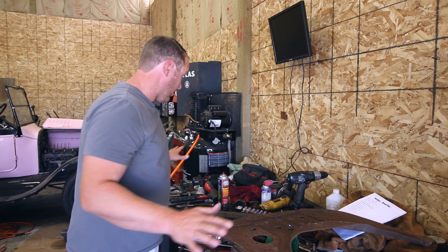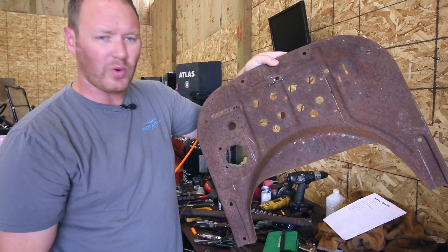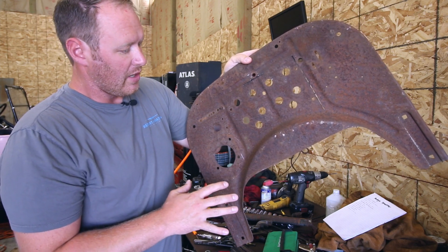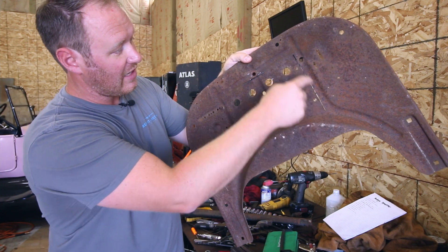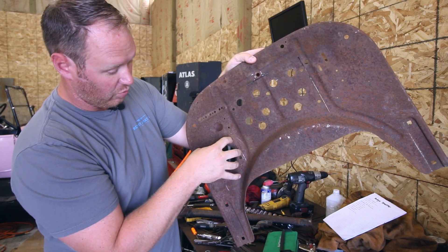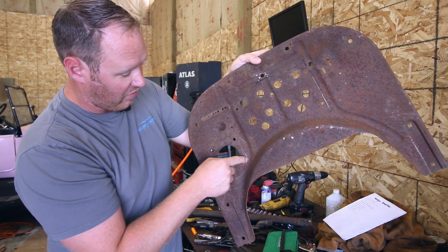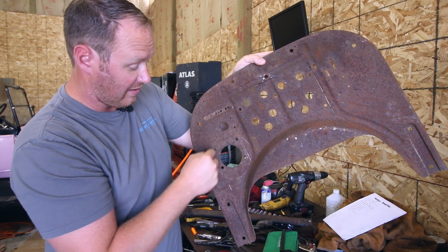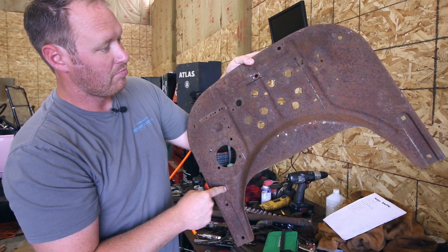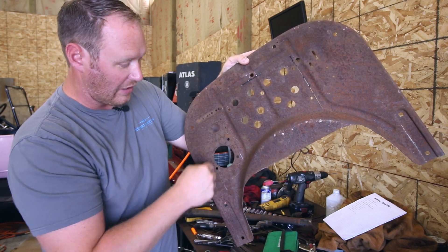Pardon the mess, because there's a lot of it. What we're going to work on is the firewall — here's the replacement firewall. We're getting rid of the wood firewall to go with this steel firewall. In order to clear the cylinder head, we're going to have to cut this section of firewall out. We also have to move the steering gear mount — we're going to move it two and a half inches down into this position, then fill this back in. I've got the new bolt location marked, so I'll be drilling a hole, using the bolt hole to recenter it, cutting out and welding that back in.